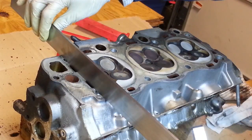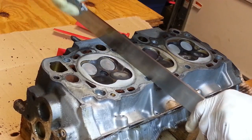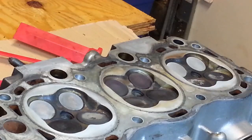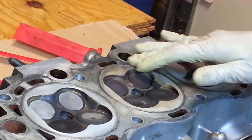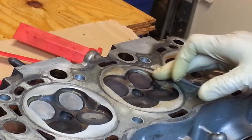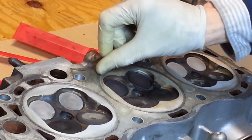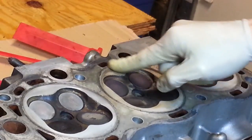This one hasn't overheated in my ownership. On a bad overheat, you can get some pretty wild warpage and the gauge will just slip right under. Now, my number four cylinder was the one that had the coolant leak, so I've been looking more closely at this particular one to find the source. While inspecting the portion of the head where the combustion chamber meets up to the coolant passage, there's one area that's a little suspect. Using my fingernail, I can feel a little bit of an indentation, which could potentially explain why some coolant would be passing through that spot.